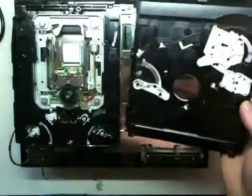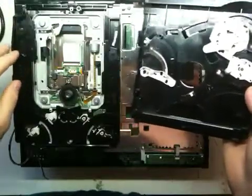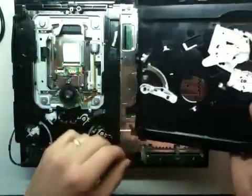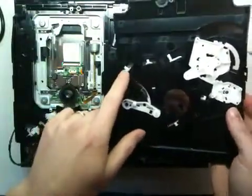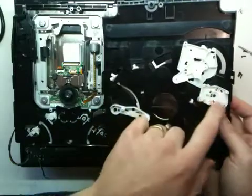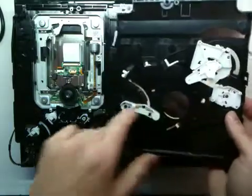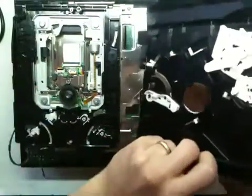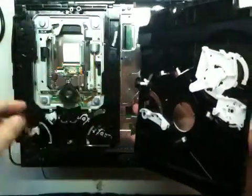In order to put this back on correctly, this left arm has to be all the way up in this position, and the right arm is down. There are two little knobs you've got to line up — here's one of them here, and the other one is right here on this little part that moves. There's another one right here that has to line up on this side. If you don't have these lined up, your disc will go in and it just won't seat properly.